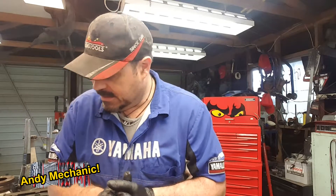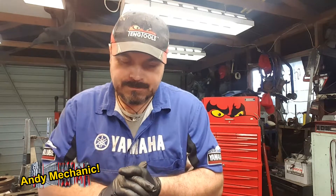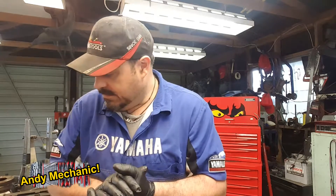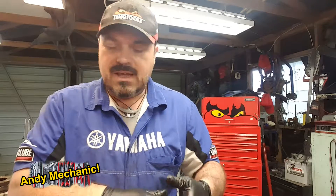It's definitely worn a bit, but it's not surprising — it's done about 260,000 kilometres and it is 20 years old. The minimum spec is 41.9, so in 0.06 millimetres time, that camshaft will be worn out. But on the other hand, if it started life at 42.01 mil and it's now 41.96 after 250,000 Ks, then it's only half worn and it's got another 250,000 kilometres to go. So that lobe's fine — obviously I've got to measure all of them to be sure.